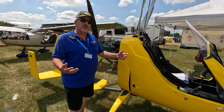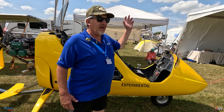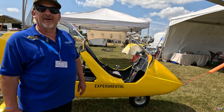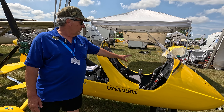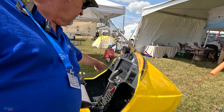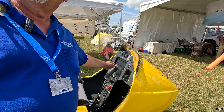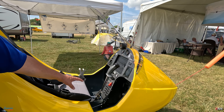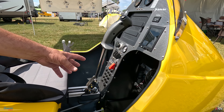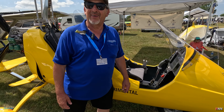That's why it's open cockpit — you want to be out in the air seeing everything. Imagine the perspective from the front seat with nothing in front of you at 3,000 to 5,000 feet over a beach. On the front panel I went a little different — one JPI engine monitor with all the engine gauges, another Avionics AV-30 that also transmits traffic into my iPad with ForeFlight. I put resettable breakers in — when you buy the package it comes with fuses, but I made a new panel with resettable breakers so I can know what's going wrong without having to stop and check.